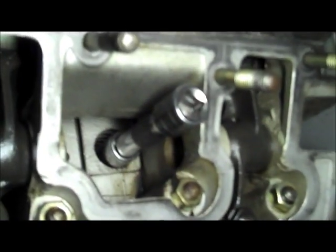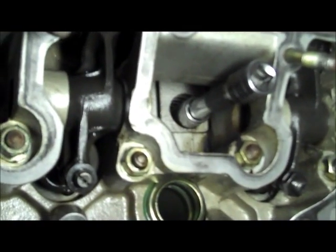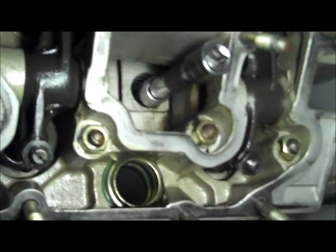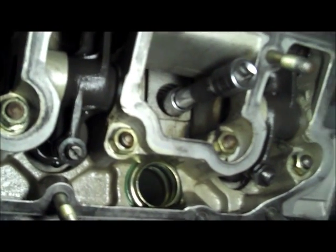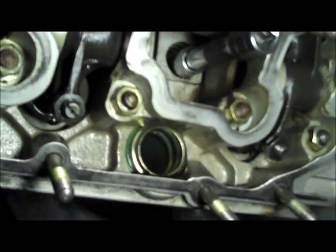And essentially you set up your torque wrench and go to 25 foot-pounds as the final spec. What you'll want to do is go in increments, at least go 3 times over on the head itself, so 20, 22, and 25. So you go across here and do 20, do the upper left hand bank, which is the intake, 20 across there, upper right hand bank, and then lower left hand bank, and then come back and do 22 and a half, and then go through the whole engine, and then back over here again for another round at 25, which is the final spec.